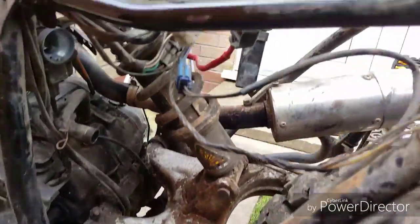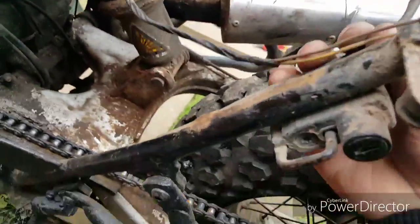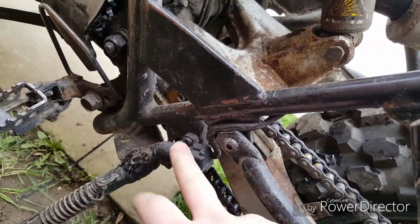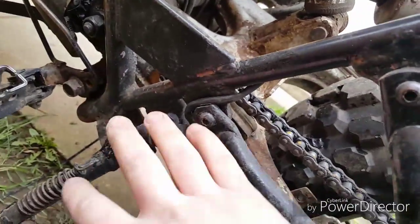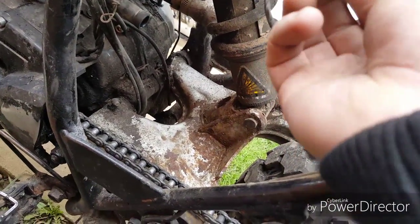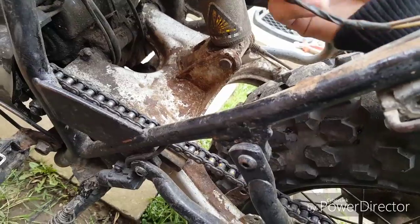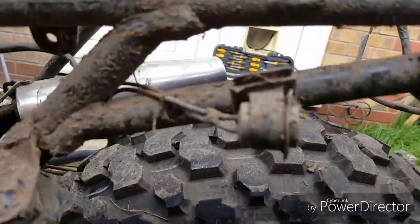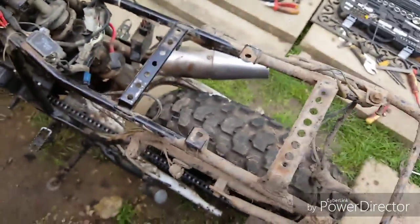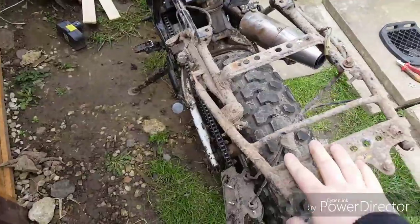You've got this rod that runs down the arm — this metal rod here that actually does your kill switch. I'm thinking of bypassing it. All you need to know is one's positive, one's negative. You could clip it, put two attachments on it, run the switch somewhere else — like on the side here so it's hidden. That way you'd have an extra kill switch in case someone tried to steal your bike and put it into gear. I made a video of this on the YBR but before I got around to doing it, the switch arrived too late.